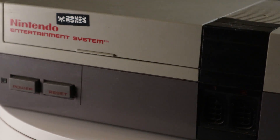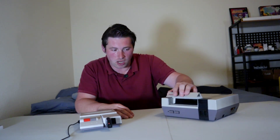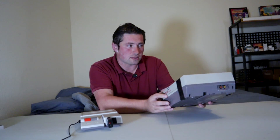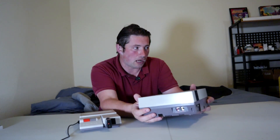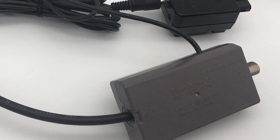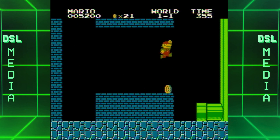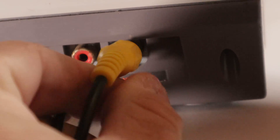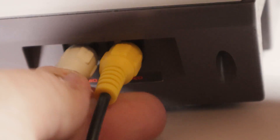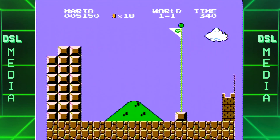I'd like to pull out this NES right here. This is an unmodded NES. With an unmodded NES, it runs NTSC games — I'll talk about the international stuff in a moment. But this right here would run standard NES games, and the video that would come out of here would be composite. If you owned an NES fresh out of the box during the 80s, it most likely came with an RF modulator.